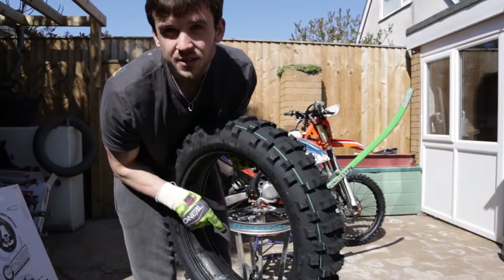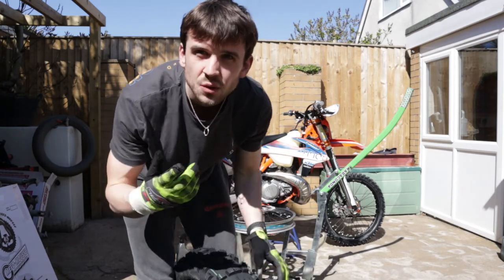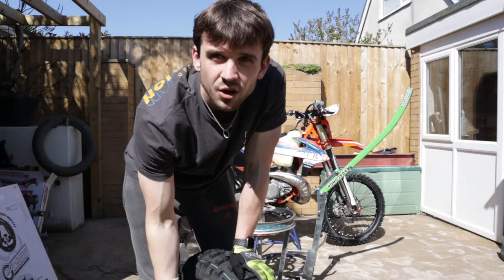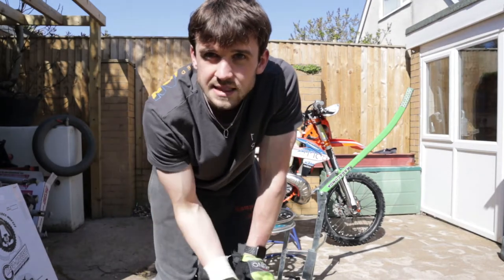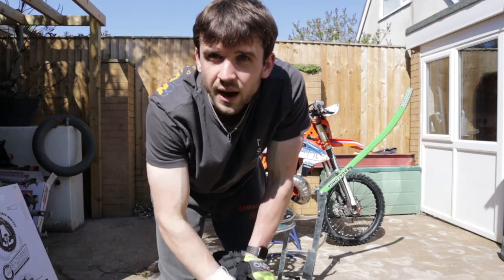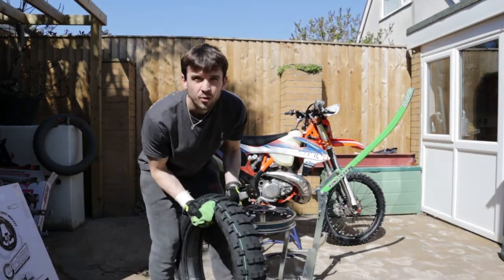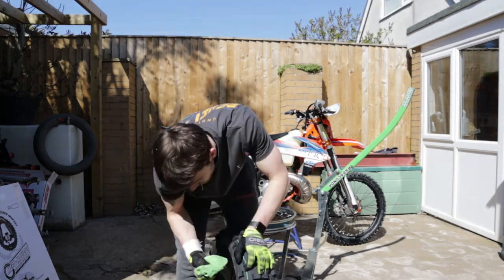Mousse is in the tyre — that's probably the easiest I've ever got a mousse in before. I think my biggest issue was always putting a too-big mousse in the wrong sort of tyre, but because this was a bundle it's the perfect mousse for the tyre. It's also a long-lasting tyre, which is really good because tyres are expensive and I'm not at the point of getting them free or having a tyre sponsor. Let's get this bad boy on the wheel. Before I put the tyre on the rim I'm going to clean the bead and get any mousse lube off — I don't want it slipping off the rim.